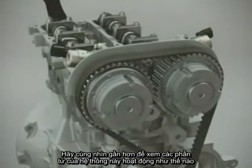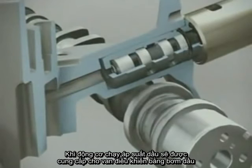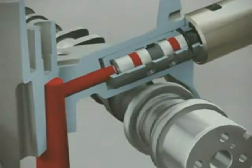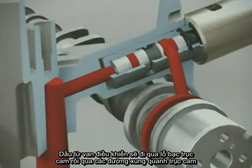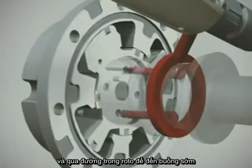Let's take a closer look at how the elements of this system work together to change the timing of the intake valves. While the engine is running, pressurized oil is fed into the oil control valve by the engine's oil pump. When the plunger is in its mid position, known as the hold position, the oil flow is turned off to all the other oil channels. If the plunger is moved forward, the pressurized oil is released into the channel connected to the advanced chambers in the VCT unit. The oil travels through holes in the first camshaft bearing bridge to a channel surrounding the camshaft, then through holes within the camshaft and through channels in the rotor vane, finally reaching the advanced chambers.